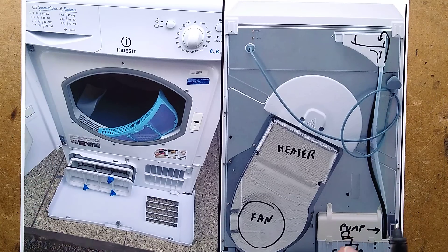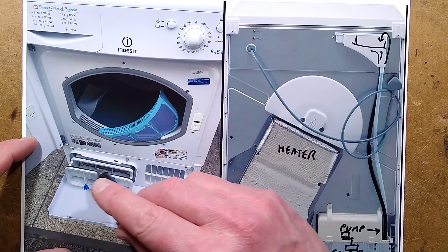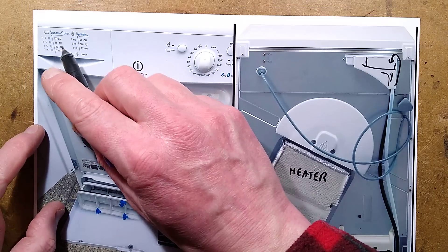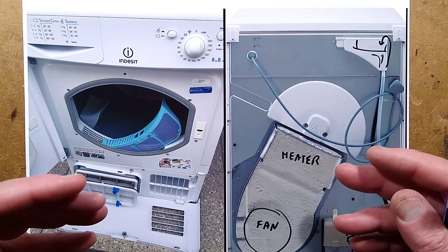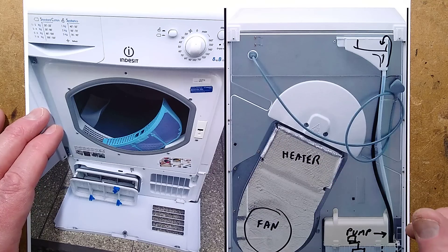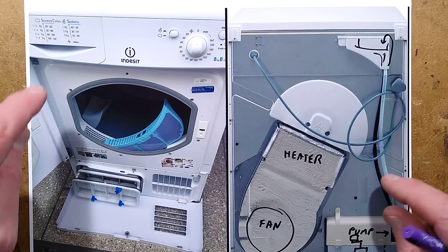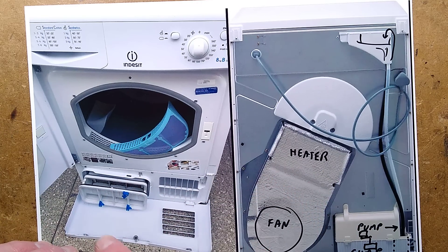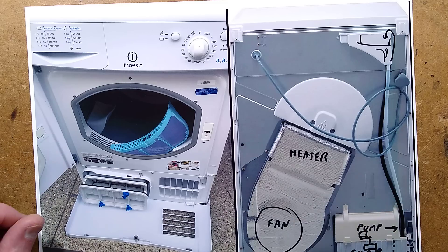So to summarise: there's the drum, the lint filter, the hot air coming out going down through a scoop to the back, condensing out, with cold air blowing through. There's the water reservoir drawer that you pull out. It's very handy — you can put this machine anywhere in your house, plug it into any socket, since all sockets here can handle a three kilowatt load. It's about a two kilowatt heater inside. For maintenance, you just empty the water chamber, empty the lint filter, and every so often pull out the condenser unit and give it a wash under the tap to clear any fluff and maintain maximum efficiency.